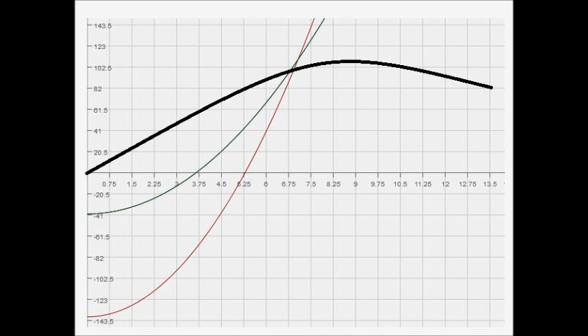In this example, the red line has more weight on the arms plus a dynamic spring hooked to the arms. It fully engages at 6,750 RPM and starts to slip at 5,250 RPM — so the transition from slip to fully engaged is very quick. Example two, the green line, has fewer static springs, less weight on the arms, and no dynamic spring. Even though it also fully engages at around 6,750 RPM, it begins to slip at 3,750 RPM, so the clutch engagement is going to be a lot smoother.